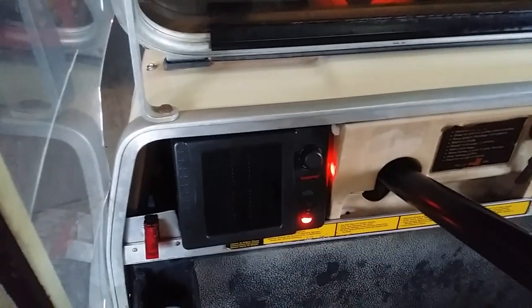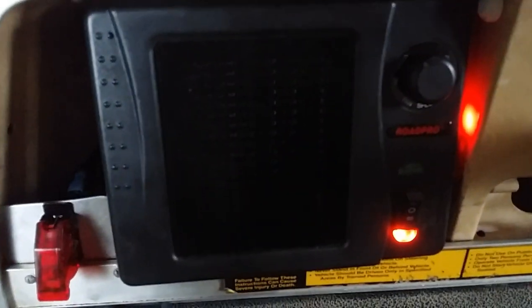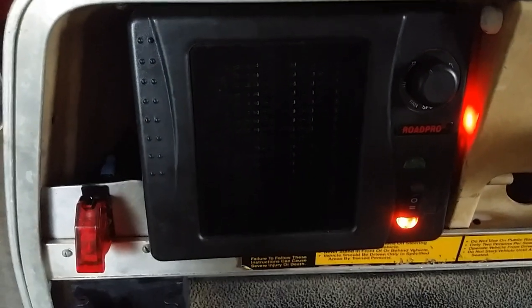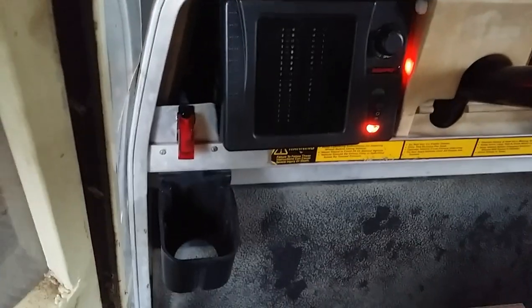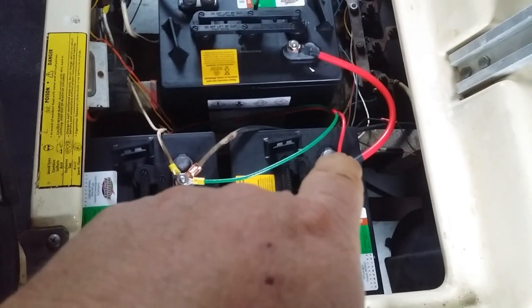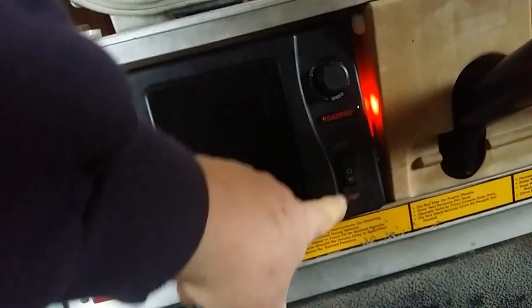I've been fiddling around with this golf cart. I had this little heater kicking around — picked it up at a yard sale years ago — and it fits perfectly after I modified it a little bit in that hole right there. It's running. It's actually more heat than I thought these old 12-volt heaters could put out. It definitely takes the chill off. It's a 12-volt heater, and we have 36 volts of battery, so I tapped one pair — positive there, negative there — for 12 volts. The heater has heat, off, and fan settings, so it'll give you a little breeze in the summertime too.